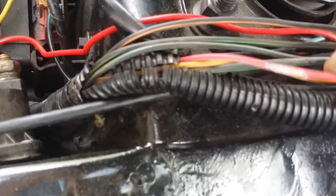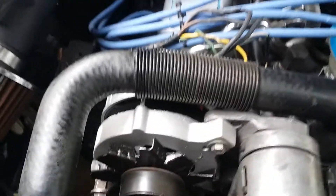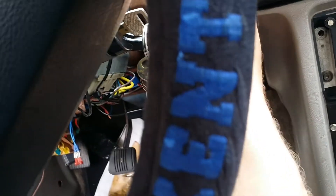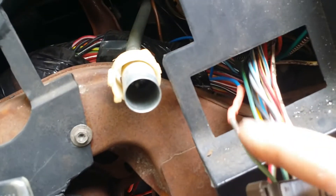This is a red wire with a green stripe in it - as you can see I shaved that back and put a hot system to that and that did not do it. So I needed the green wire with the little red stripe. I don't see it here, but I could have gone over here and cut into this and hooked it up to a 12-volt wire. Since I had the dash all torn apart I'm showing y'all how to do it in here, but you can actually go up underneath the dash and find that green and red wire. It needs to be the green wire with the little red stripe.